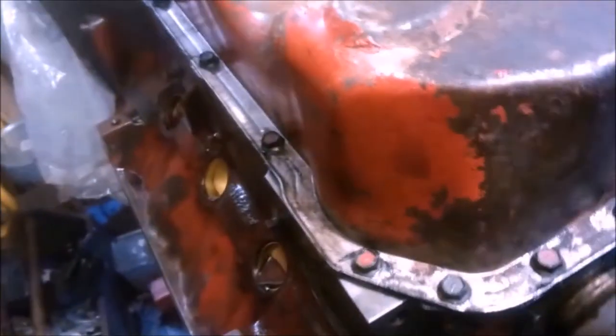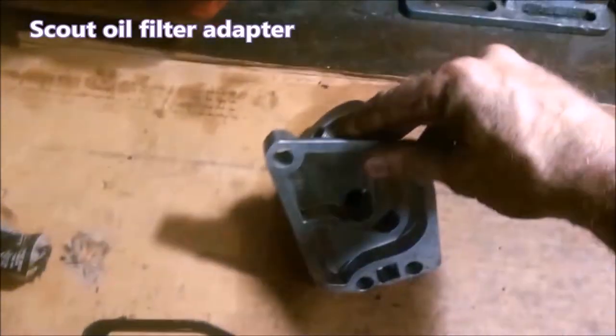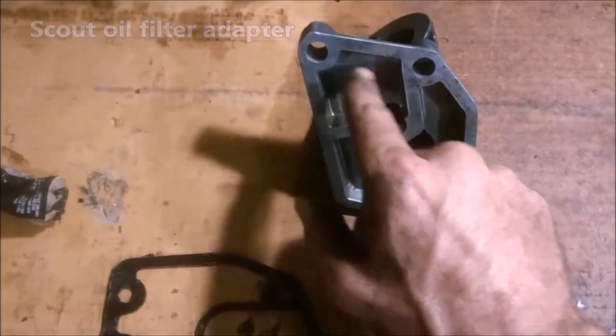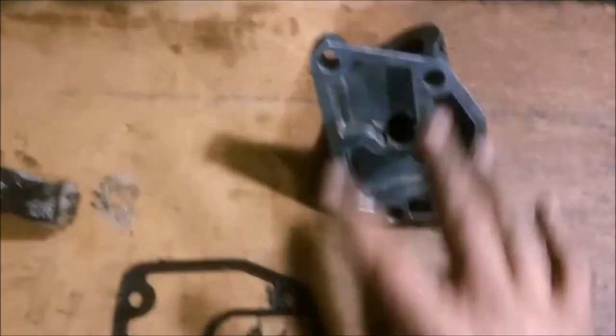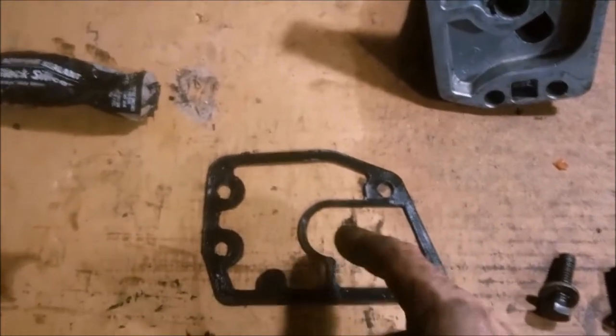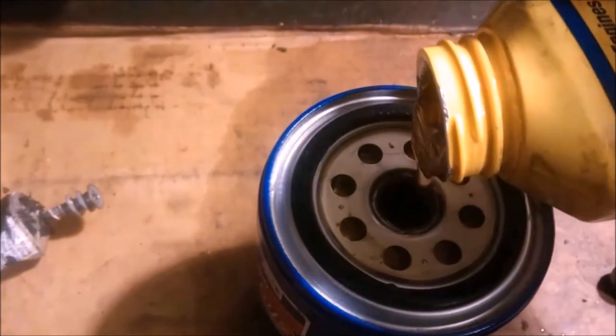Put a little dab of oil where recommended because the cork likes it when seating up there. Install our pan just hand tight with a little quarter-inch driver. We're only putting the slightest film on one side so it's tacky to the part that comes off, not the block — just like we do to everything. Be very careful with this stuff — it clogs in places inside motors. Wipe off the edges and the inside with a rag, and add the zinc to the filter.